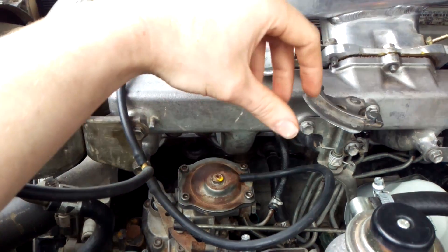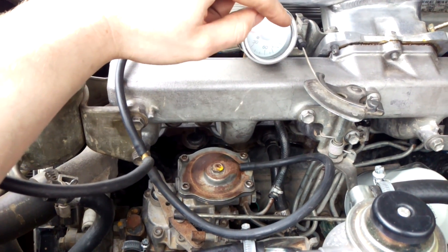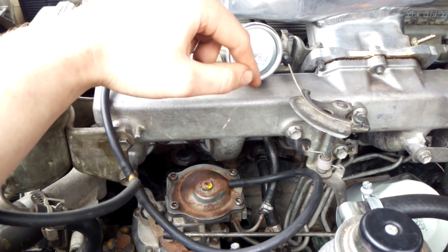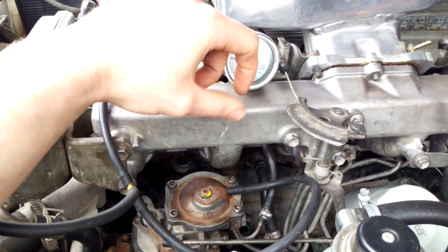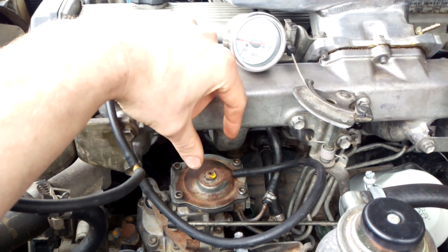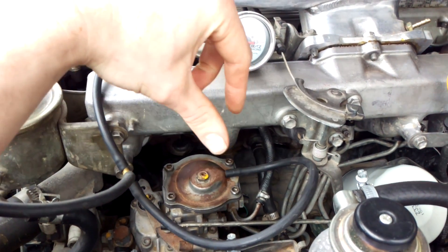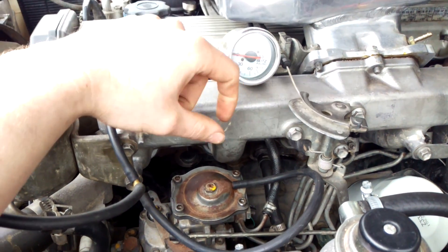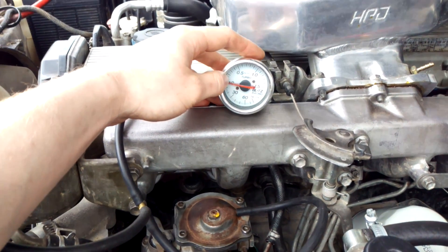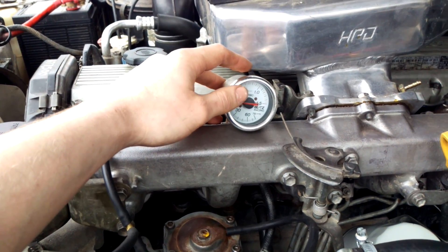I'm going to operate it to hit one bar a few times, then take the cap back off, take the aneroid pin out, and the follow-up pin will scratch a little line so you can see what it's actually injecting at. If it's going up on the ramp, we're going to have to increase the tension of the spring a little bit with the clicker wheel. To increase spring tension you turn the clicker wheel anti-clockwise, which will make it come up and increase spring tension. Just keep trialling that until you get a nice result.